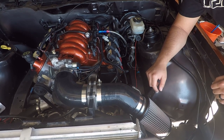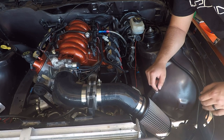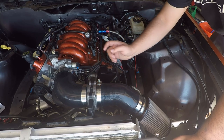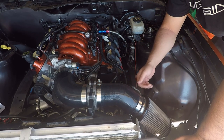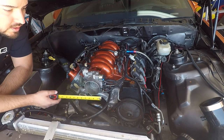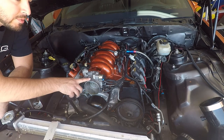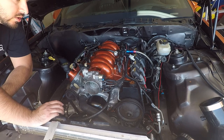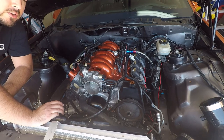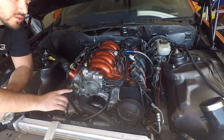Before you decide what pieces you want to buy, first thing you've got to do is take your tape measure and measure the outside diameter of the throttle body and your MAF sensor. The air filter size is going to depend on which filter you decide to buy. So first things first, we're going to measure the distance across on our throttle body — it is four inches. This came off of a 2002 F-body, so if you have an F-body this video is going to be really useful. If you're using a truck intake or a four-bolt throttle body, your size is going to be different — it'll probably be larger.